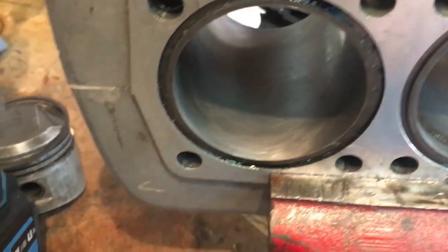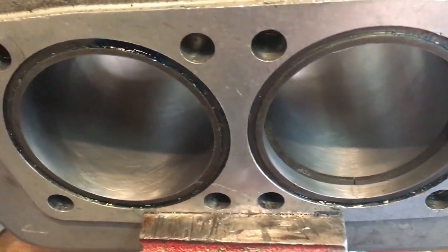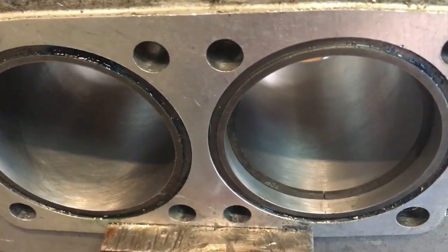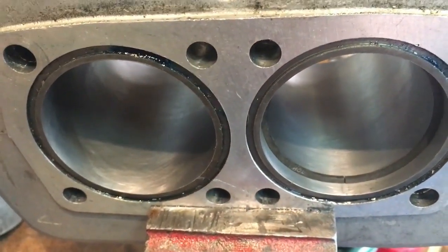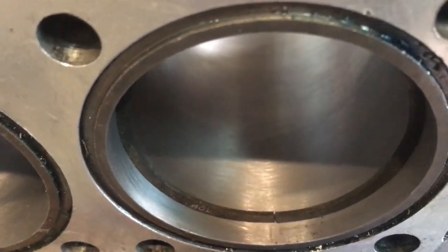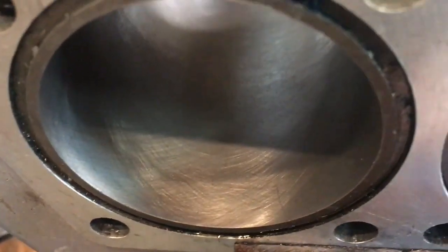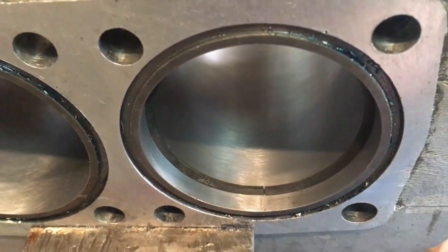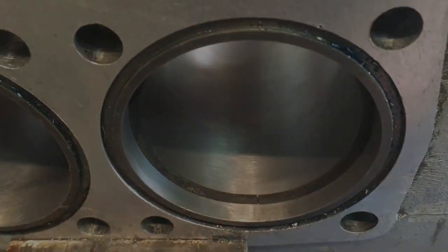You can see it's brought the bore up beautifully. Now hatched and glaze busted too. I'm just going to give a very light go now at a very slow speed to get some cross hatching. You can see, as we've been going at high speed with high tension on this side, we haven't got the hatchings that we've achieved on that side. We'll just do a very light one now on this side, and that should be it then. So 2 secs and we'll be done.